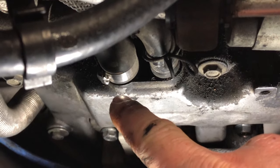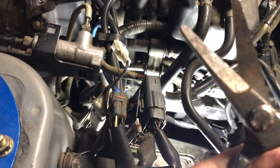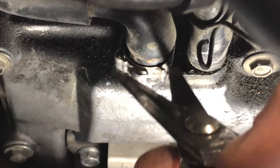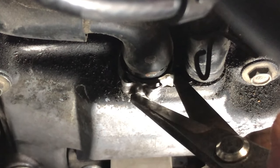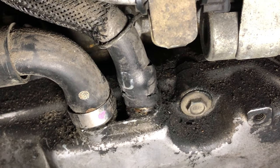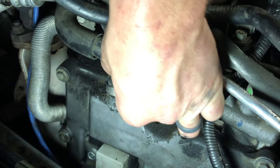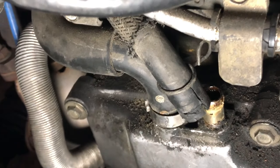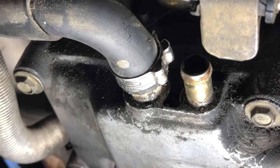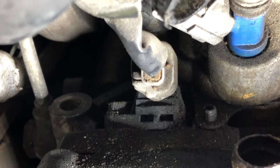This is the easy clamp — just push it in and pull it up. This other one gives you trouble because it's like a one-time-use OEM clamp, but there is a way to reuse it. I take a pair of small snips, pinch at two points, and it should unclip. Well, just my luck — my hose started to crack a little bit. It's just so old and rock hard at this point. It got pretty messed up and started flaking away. So I just kept prying, wiggling, and prying, and eventually it broke free. Now we should have easy access to the sensor.